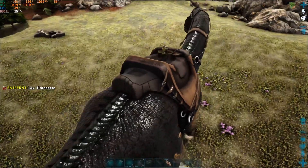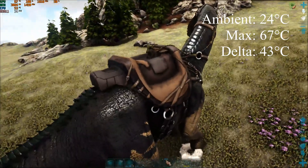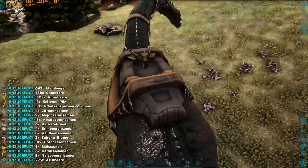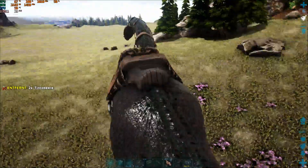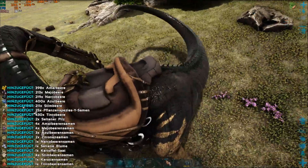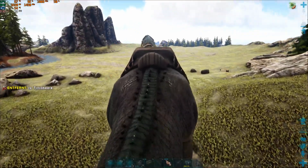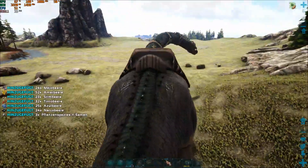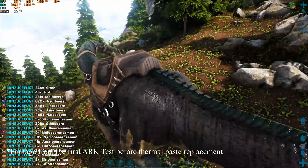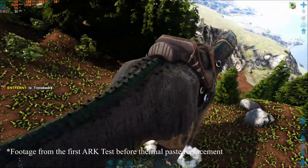In this final test, we get the same result as from the test before. With an ambient temperature of 24 degrees Celsius and the maximum GPU temperature of 67 Celsius, there is a temperature delta of 43 Celsius. All in all, there is a 3 degree Celsius temperature improvement comparing to the first two tests, which showed a delta of 46 Celsius. I don't think this has much of an impact, if any, on noise. After seeing and feeling the thermal paste, I already expected it to not make much of a difference. Don't see this as a common thing — most of the time you even get a temperature improvement if you replace stock GPU thermal paste right out of the box. In this instance, the manufacturer — Sapphire — is known to make good AMD graphics cards, and I never expected the paste to be that good after 5 years of use. If you have a similarly old graphics card, you can expect a bigger impact on temperature than I experienced here.